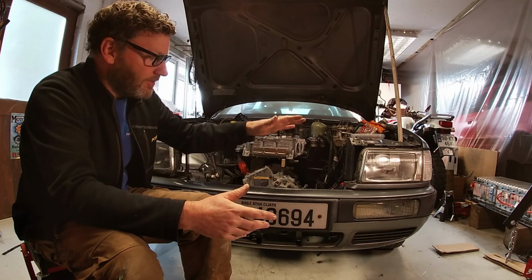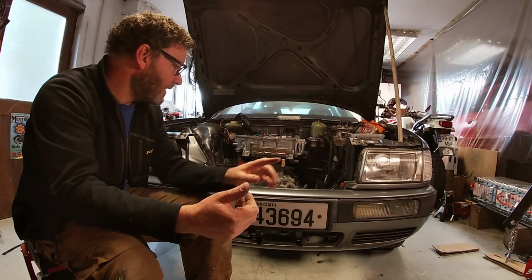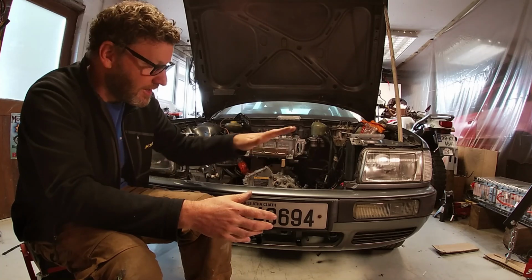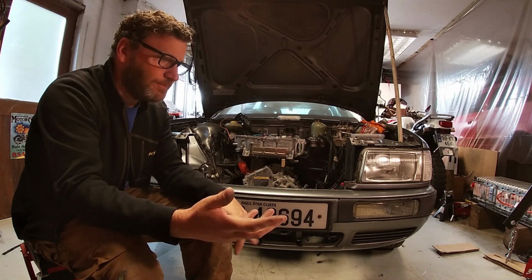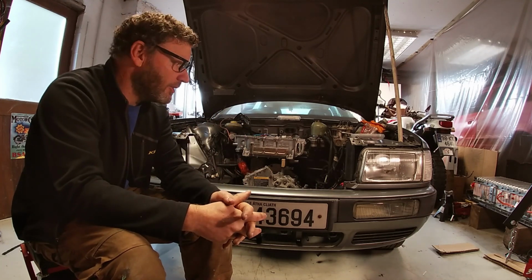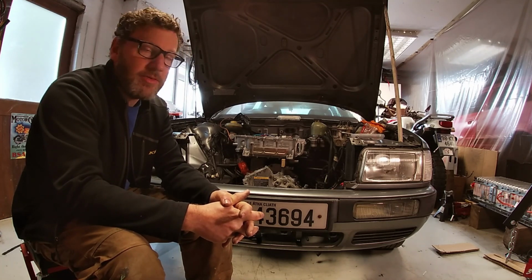You can design certain platforms that will fit certain types of subframe and chassis. So in essence, this could be a kit. If somebody came along and wanted to do an Audi 80, they buy the plate, they buy the mounting points and all that, and the rest is very little. I'm doing all the work here, just figuring it all out. But imagine doing, say, a Mark III Golf, which shares the same platform with the Jettas and Passats. I know they have transverse and longitudinal engines, but a lot of the other bolt-up fittings will be similar. That's why I'm doing this, out of interest, and to see how far it will go on the 24 kilowatt pack.